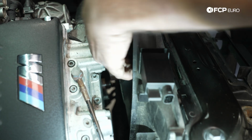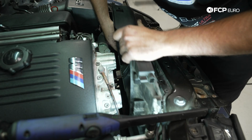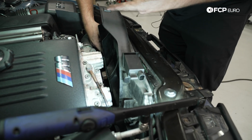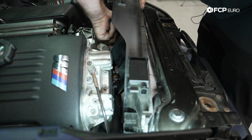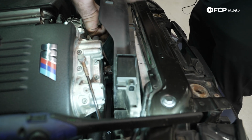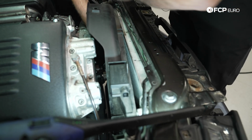And what we need to do is get the fan clutch started on the water pump while also getting the fan shroud lined up and clear of any kind of obstruction. It's a good time. So we're there, and we need to spin this counterclockwise as we're facing it, but actually it's going to be spinning to the left since it's reverse thread.